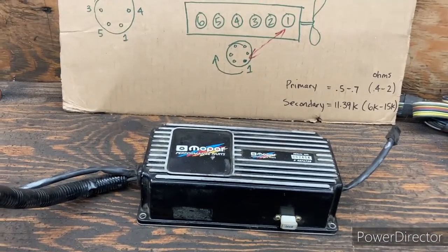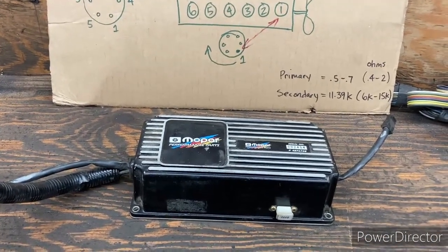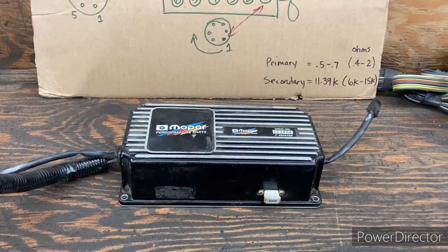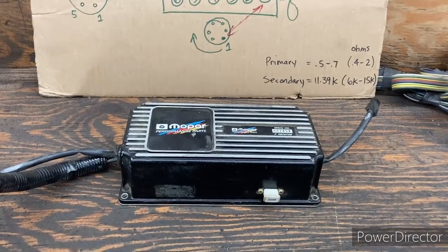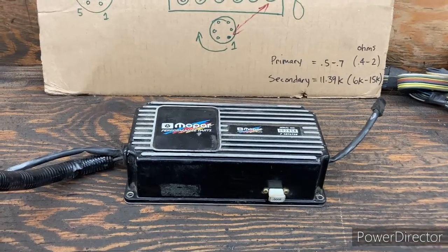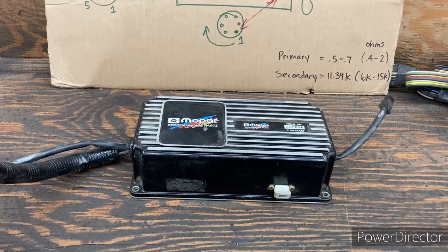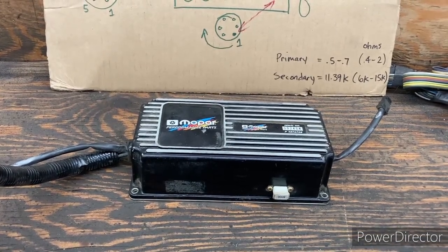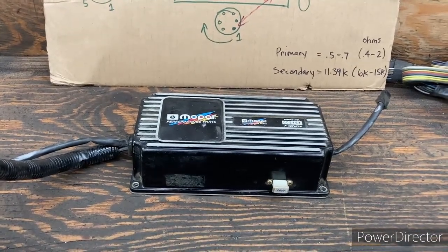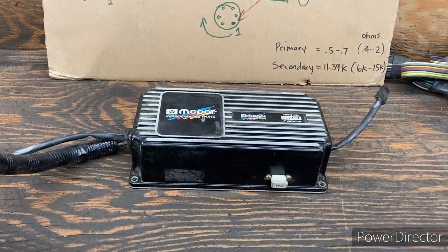You find something that needs to be repaired, repair it. And now we go back to the beginning, and now that we've proved we got our fuel, we prove we got our ignition, our spark, now we go back and air is last. So air is going to be determined by your choke and your idle setting. So now this is where you're gonna fine tune your carburetor for your air and your fuel, and the metering screws will adjust the amount of fuel that's going in.